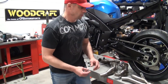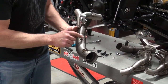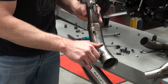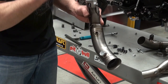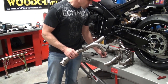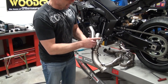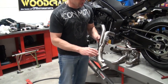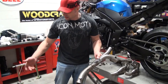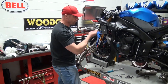It comes with two bungs. You've got the lambda sensor that the bike has installed, and we're going to use one bung to mount that. It also comes with another one that will accept another tuning sensor — we're not going to use that now, so we're going to go ahead and plug that off. I'm going to save the plug for the lambda sensor, just because you never know what might happen in the future. I had to take the mounting bracket that holds the mid-pipe in place off the stock piece, and it was impressive the way they did that — no cobbling whatsoever, it fit perfectly just like it did with the stock piece.